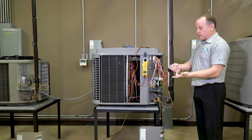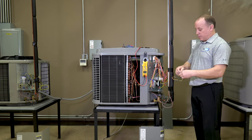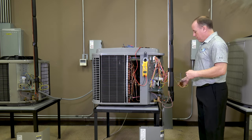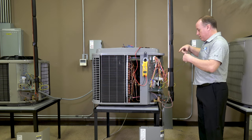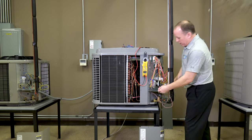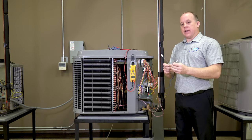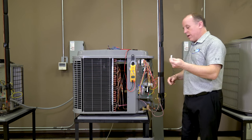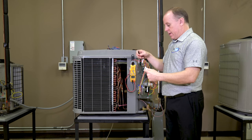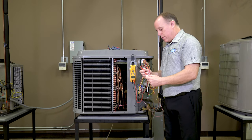It has a low and high side and they're tied in in series. So we're going to separate that. I've already killed power to the unit so there is no power going through this unit — I'm safe on that side. I'm going to remove the plugs on that switch, get those wires separated, and then insert the leads from my meter to check the continuity of the switch to see if we're open or closed.